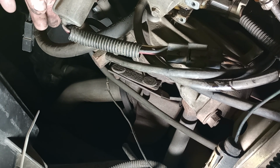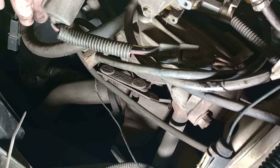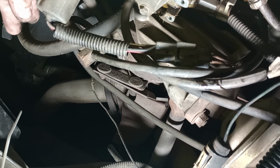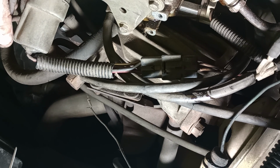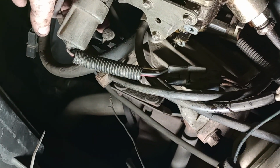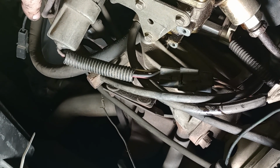All I know is when I first bought the truck and started driving it, I would get it running for maybe about 15 to 20 minutes. Then the engine would seem like it was starving for fuel and completely choke out, and I couldn't get it running again until it had cooled down. And no, it wasn't overheating. I determined that it had a massive vacuum leak from this port right here. Didn't have anything hooked up to it. I tried putting a vacuum cap on it, but the cap just kept getting blown off. So I decided, screw it. I JB welded a bolt into a section of vacuum line, and then clamped the other end of the vacuum line onto that vacuum port, and the engine has remained running ever since.